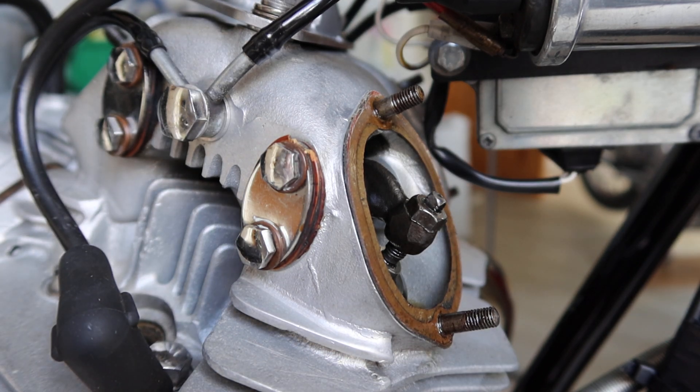About 20 years ago I wondered why my brand new genuine Andover Norton valve tips had great gouges in the tops after only 3000 miles. My valve seats weren't recessed, so I took the head off, took the valve springs out to see the action on my knee as I operated the valves with my hands. I discovered that if I held the valves 80 thou off the seats and turned the adjusters in 80 thou, I was then getting a rock with no sliding motion at all.